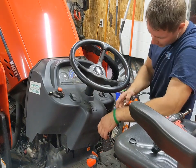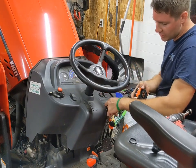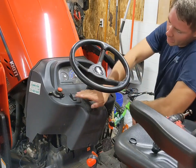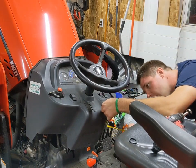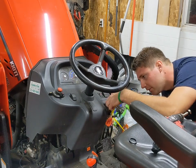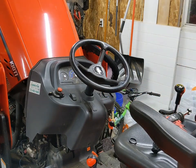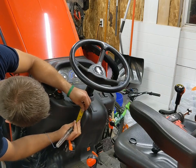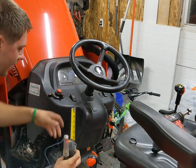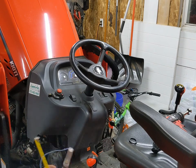So for symmetry purposes, I decided to put it here, just like the key is. I'm going to take a rough measurement real quick as far as where the key sits in relation to this edge and this edge, so I can get an idea on my center before I drill my hole. We are approximately an inch and a half down to center, and an inch and a quarter from that edge. That gives me my target.